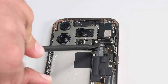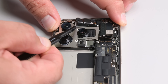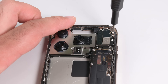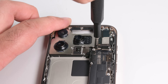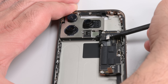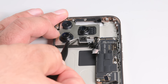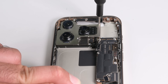Moving to the upper assembly, detaching a couple of press connectors allows me to remove the front-facing camera and Face ID sensor. I can also remove the earpiece speaker and the vertically oriented millimeter wave antenna. While the iPhone 16 and 16 Plus lost an antenna but kept the same orientation as in the iPhone 15s, the Pros are the only ones that received reoriented millimeter wave antennas. The LiDAR scanner is now removable independently of the main camera assembly by removing just two screws, and optionally the main camera assembly and LiDAR scanner can be removed together as one piece.